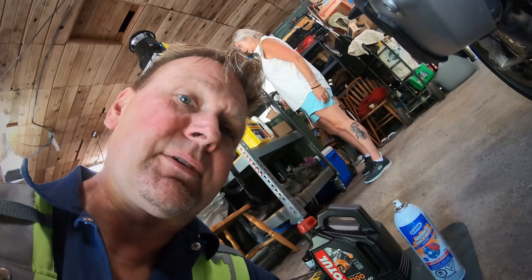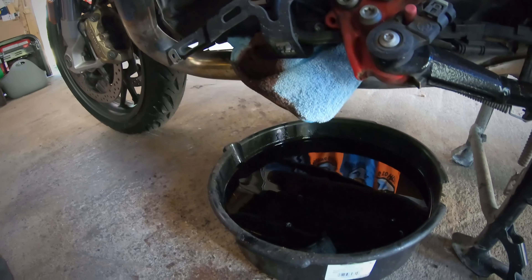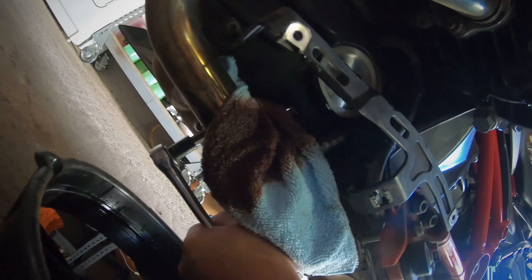At this point I'm going to put the drain plug back into the bottom of the engine. It's barely dripping as you can see now. I had a crush washer in my box that I put on there, which is good — I just collect a bunch of stuff and have it for later. I've got my socket on there, I'm going to give it a good snug up. There it is, and I will do a check to see if it's leaking afterwards.